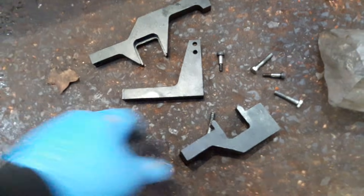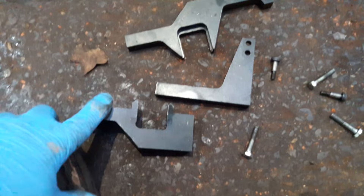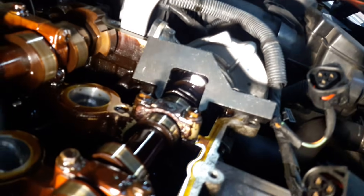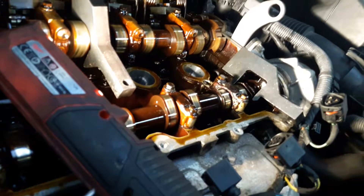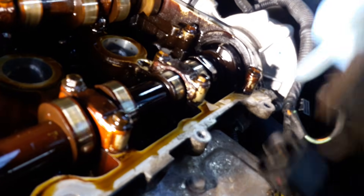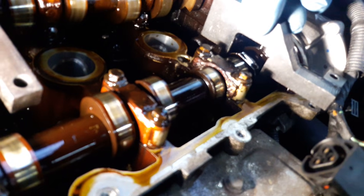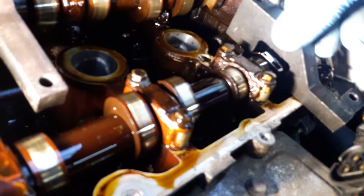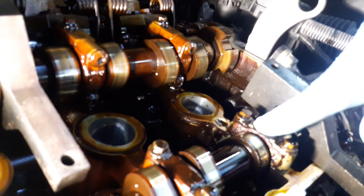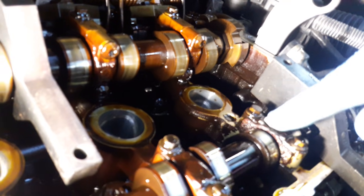This is the second part of the kit — I'll assemble it and then put it onto the car to see how far out the timing is. I'm trying to locate the locking pins for the exhaust cam. This should fit perfectly level, but as you can see, trying to get it down it doesn't — it locks in there and it's not even straight with the engine. So this exhaust cam is definitely out.